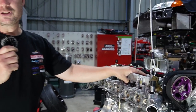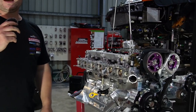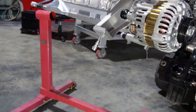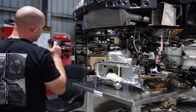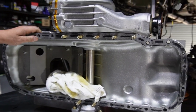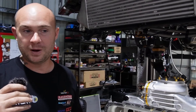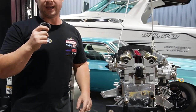Knowing me, I just couldn't sleep at night without pulling the sump off and checking our rod bearings. So that's where we're at at the moment. We've got the subframe on the bench over there and we've also got our gearhead sitting up nice and straight. It's pretty cool to see everything brand new - I've never actually pulled a GTR apart before with all the new parts on it. Today we're going to do a quick check of the rod bearings, flip this motor upside down and check it out.